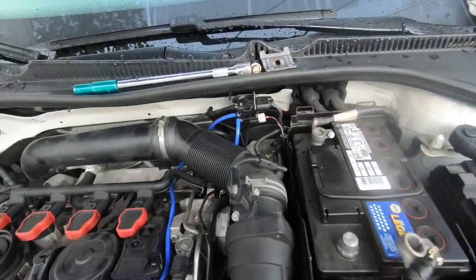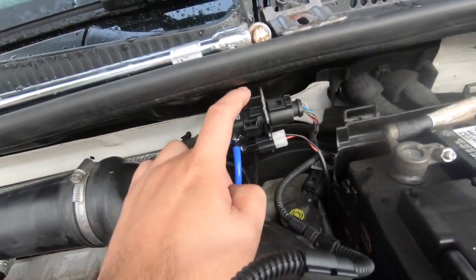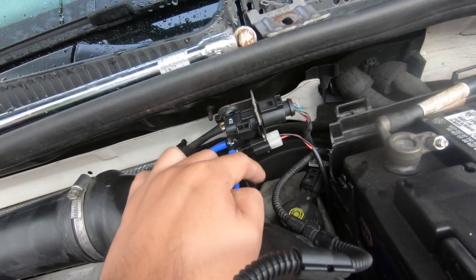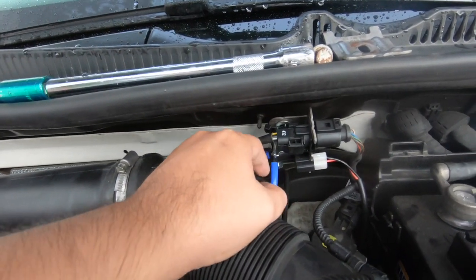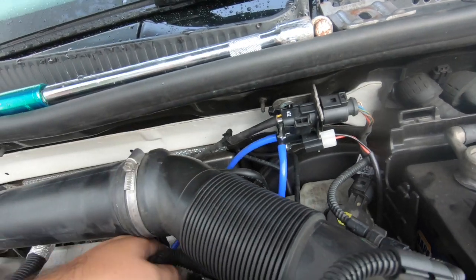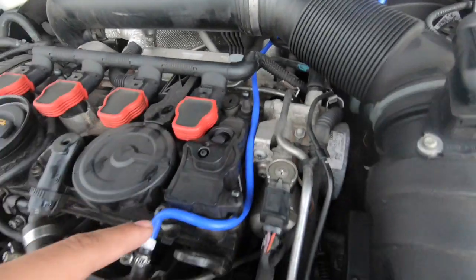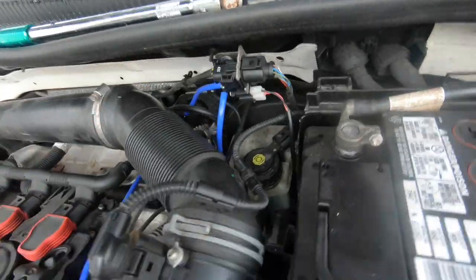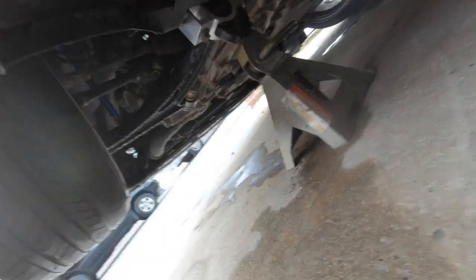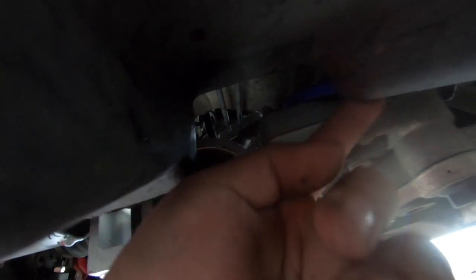The bracket for the O2 sensor was down here, so I moved it up — there's a hole back there, so I put a zip tie in there. The switch is nice and tight. The vacuum line runs all the way over here with a zip tie — it goes to the boost tap, either here or here like I said. Follow the other line all the way down, but keep it away from the exhaust because it will definitely melt. Come through here — the exhaust is down there — pull the cable all the way and go underneath the subframe to the hole underneath the plastic by the control arm, then feed the line under there and pull it out.